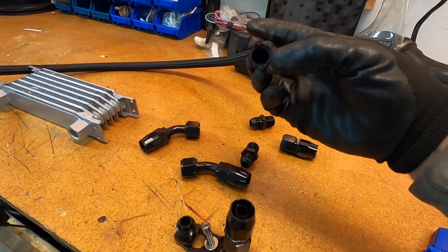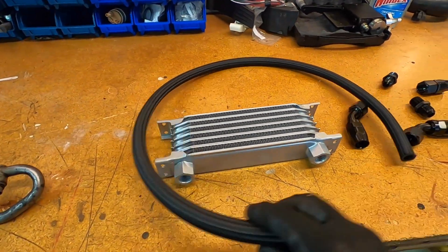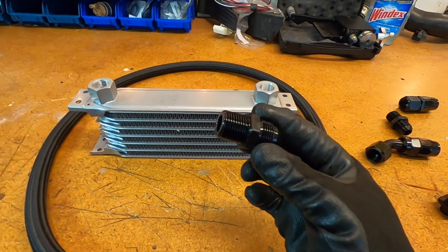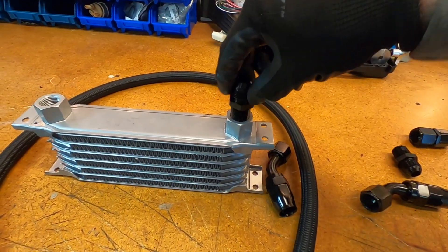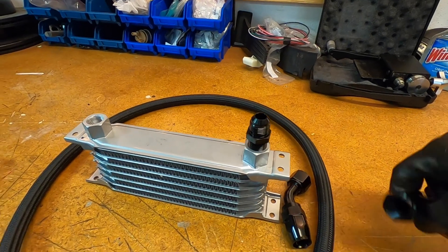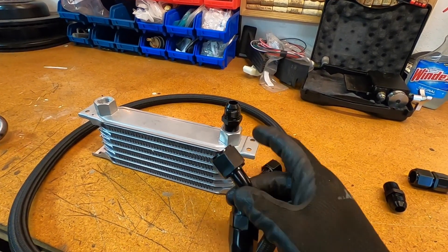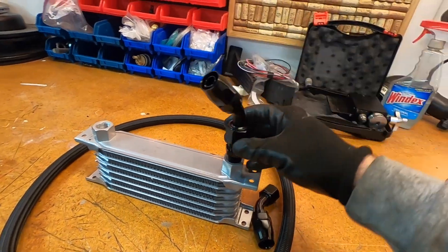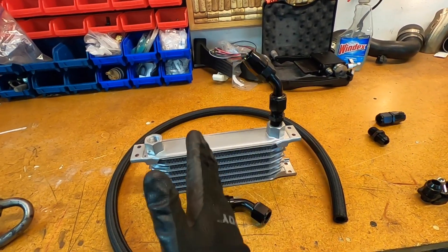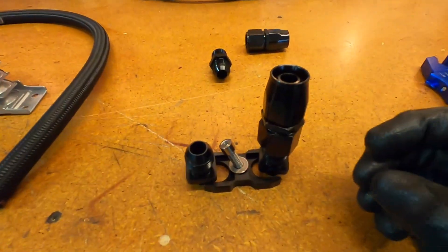This is a nylon outside, but there's also stainless steel reinforcement within the tube. I've got just about enough length of tube to do both sides. It goes into this oil cooler here, which has NPT fittings — National Pipe Thread fittings — on one side that screw right into these adapters, and then the AN10 fitting, which is what we call a JIC fitting. We have a 45-degree adjustment where the hose goes into this side, and it will position the oil cooler offset so both lines can go up right in front of the radiator and into the existing locations.